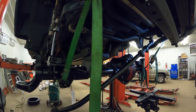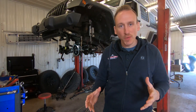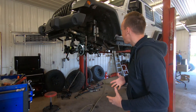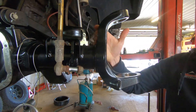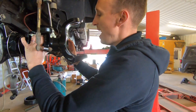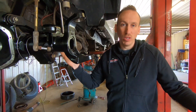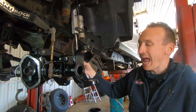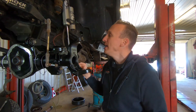Herm's doing a great job working on the front axle. We've got the whole front axle assembly installed into the Jeep and he's working on the ARB installation right now. I wanted to point out a few differences of this axle compared to the old one. These knuckles are huge, especially compared to a stock one — that's really good because it prevents bending. The axle tubes are massive with a half-inch wall. I also like that the shocks are outboarded a little bit wider, which makes for a lot more room during articulation.